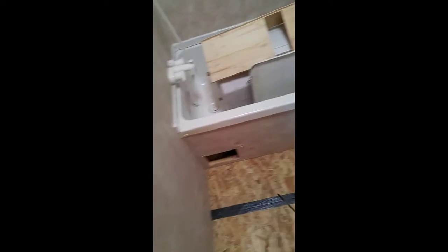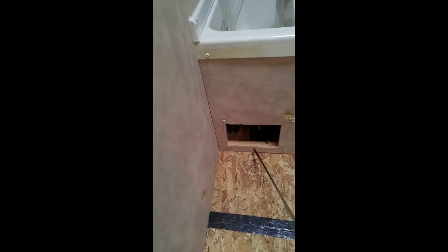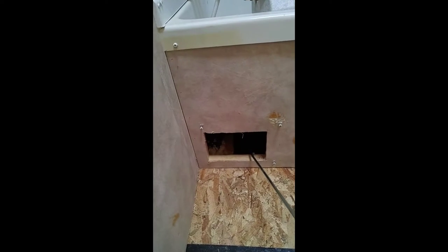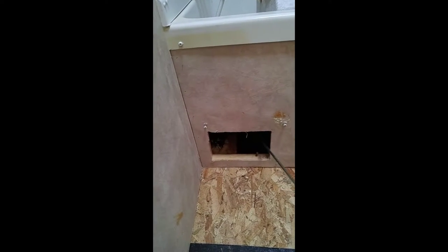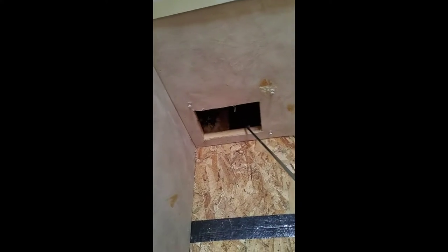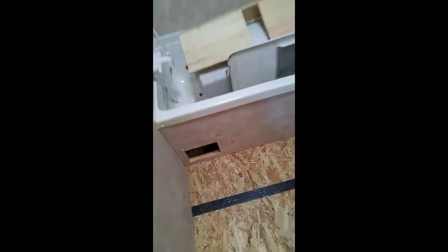This is just the access to the tub. There was a little bit of water down in there, so I think maybe one of the fixtures is leaking. Once I finish this, I'll do a water test and see if it's leaking and then repair that. There's no rot or damage, but there was a little bit of water in the insulation that I removed.